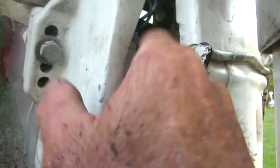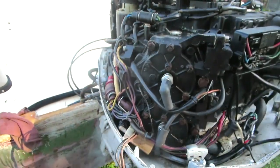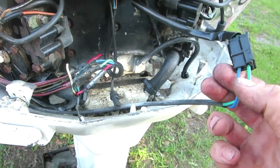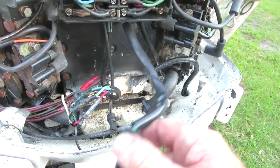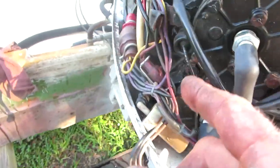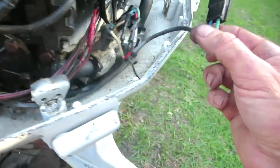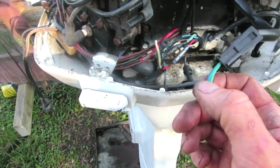Put it all back together, then you can test the motor by putting 12 volts to one side and ground on the other — keep flip-flopping them. I did a short video on that where I blew my little 20-amp fuse. That's a little tiny 20-amp fuse in here. That's how you can test your motor independently.